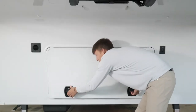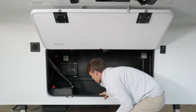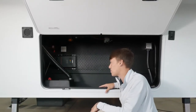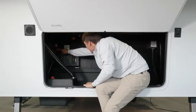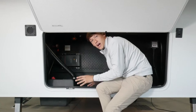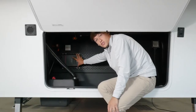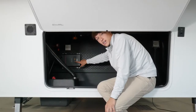Up front your bulkhead storage here will open your baggage door and you have two latches up here to hold it open. On the left-hand side we have our battery box that is recessed — it's big enough for two group 27 batteries — and on top are your positive and negative connections for easy access. Up top you'll see the big positive going to your second battery disconnect, and that's going to be your kill-all or storage mode to make sure everything's wiped out when you put it in storage. Over to the right-hand side is going to be your 50-amp MPPT charge controller that's going to be run off your solar.